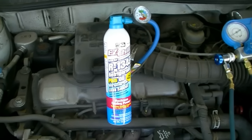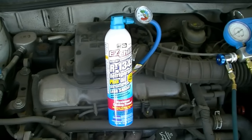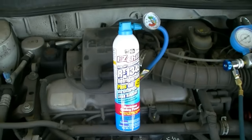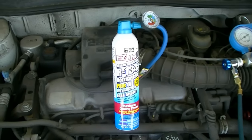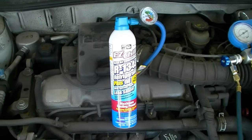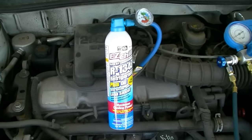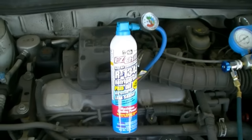Today I'm going to show you how to add Freon to your AC system and also get your AC clutch to engage, in case it's not engaging. That's a necessary step — if you need to add Freon, it's not going to suck in the Freon unless the clutch is engaging. When your Freon gets below a certain level, the AC pressure switch sends a signal to your computer and shuts off your AC compressor, to prevent damage to other components.